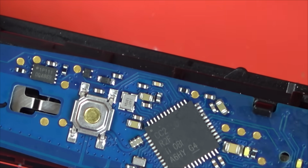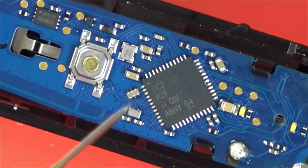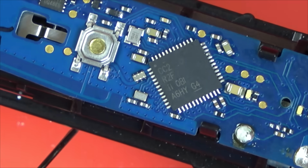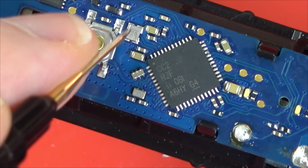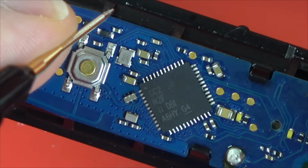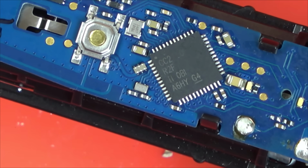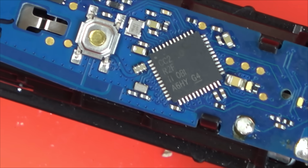So if I bring the top of that capacitor to ground, in fact, let's get the multimeter. So that's the test point there, isn't it? And I just want to see, is the case off this button grounds? No. No, so that's not currently ground. Okay, well, let's get a 1K resistor. I mean, do we need the 1K? Can we not just short it directly? Let's get the 1K just because it worked for the guy.